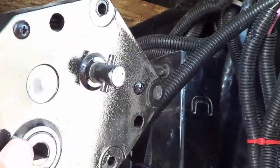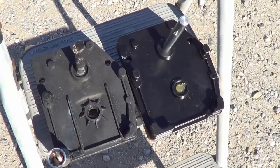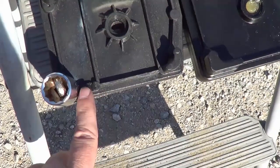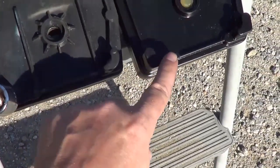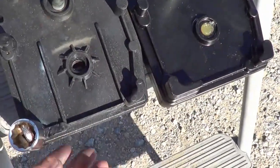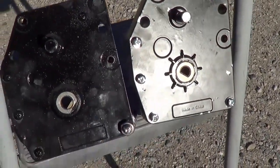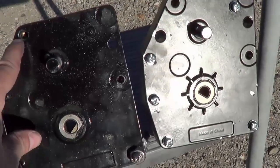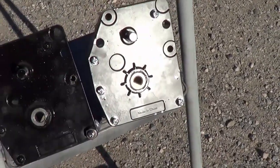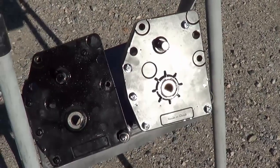Let me take this and have a look to see if it's going to match up with the new unit I just bought. There's the old one and the new one. They are a little different physically but looks like all the major components are lined up right. You can see here's where this plastic piece just sheared right off on the old one. This old one's made of a composite plastic; the new one's aluminum. The motor mounting holes look the same. It's advertised as a 3-to-1 ratio gearbox and as a replacement online for the Atwood model, so we'll give her a try.